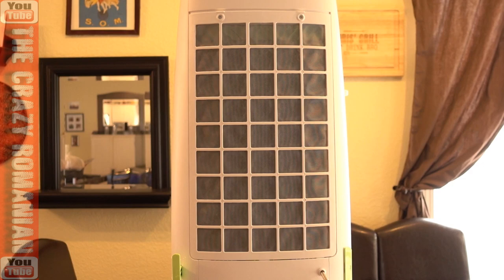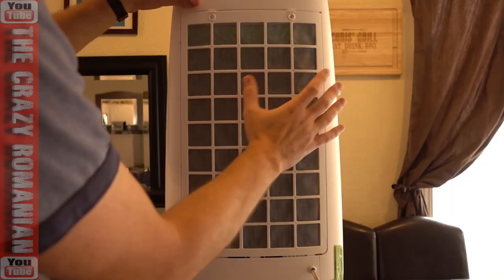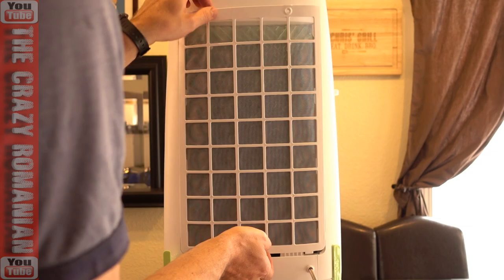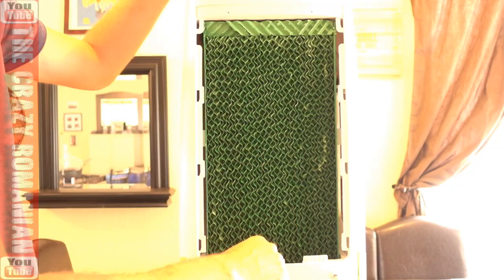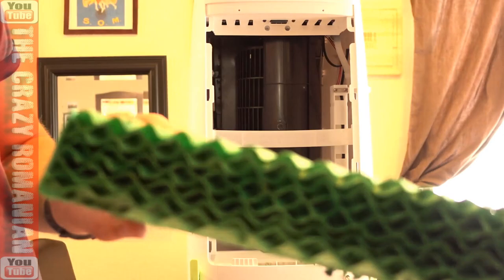Now there is a pad over here. You can also check the pad — you're going to need a little Phillips screwdriver to take it apart. Remove the two screws on the top. Once the screws are out, you can just lift it a little bit and then it should come out — it has a little socket, you just lift it up and it comes out. This is the cooling pad. The water trickles on it and then falls back into the tray. You can order these from newair.com. As you can see, they're just very thick pieces of cardboard.